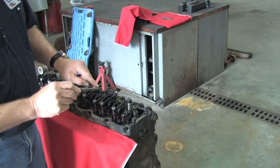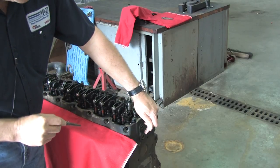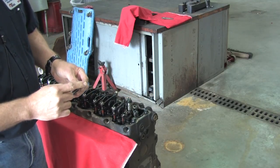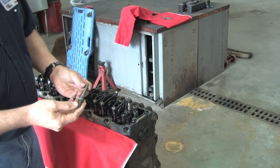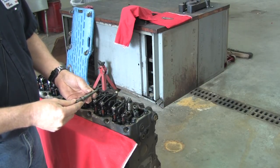And also if you don't, you can cause diagnostic issues, because the leakage here will have high flow. And you may think it's got bad injectors when all it is, you're not getting a good connection here and it's causing your high return flow. But again, I have to stress, every time we change an injector in this shop, it always gets a link.